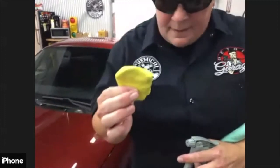Now, here's Lynn, yeah, on the bar, you're using the yellow bar for a clean car? Yellow bar is for a car that has very minor contamination, whether I just bought it brand new or it just feels kind of gritty, it doesn't feel harsh. If it feels like 50 grit sandpaper or 100 grit sandpaper, you're probably going to use a heavier clay bar.